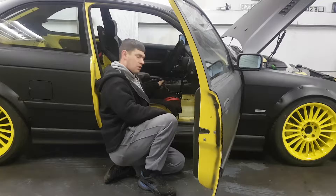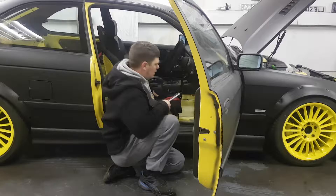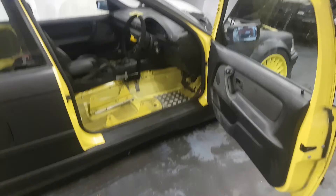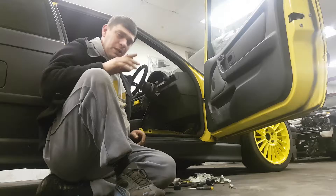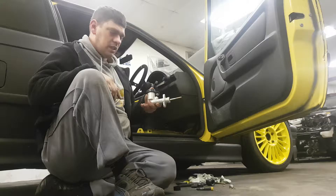So we've got the e-brake here, which is a very snug fit. The e-brake doesn't work so I'm going to swap the cylinder on the back of it. To do that and get to the pipework you have to basically take the seat out — pain in the arse — but once the Wilwood one's in, hopefully that'll be the last time we'll ever need to do it. The seat is out now. You can see I just ran the brake pipes on the inside originally. That's obviously going back to the rear brakes — two pieces off there, the flexes, and the original pipe comes in over here, which I'm going to remove, and goes up to there. So this one is coming out and the new cylinder's going in.